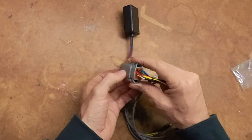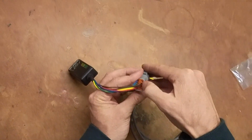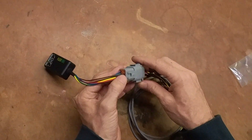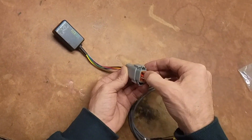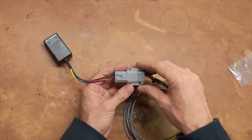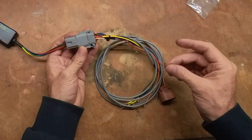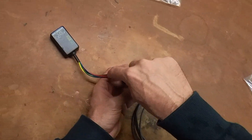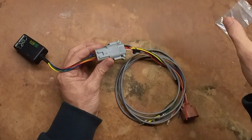Pin 7 is the red power wire. However, on this side, pin 7 is the black ground wire — this is not correct. The black ground wire on pin 7 should be aligned with the black ground wires on pin 8. So what's happening instead is you're pulling power into the red wire and it's pushing power into the ground of the flex fuel module.